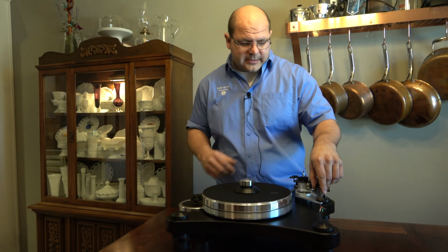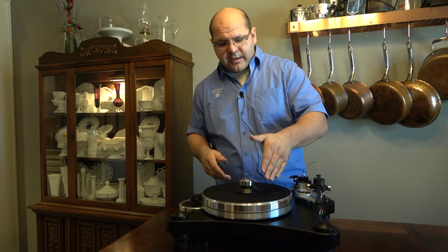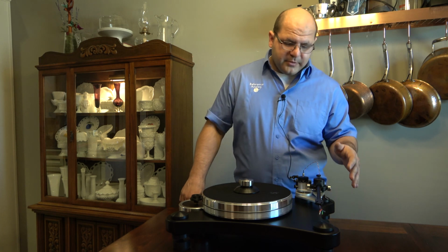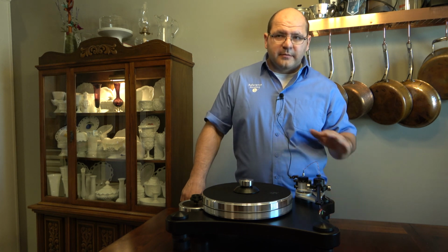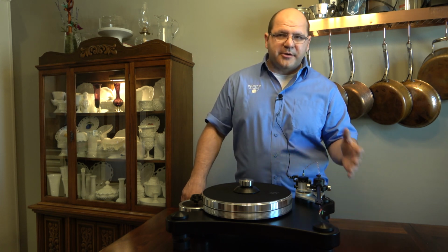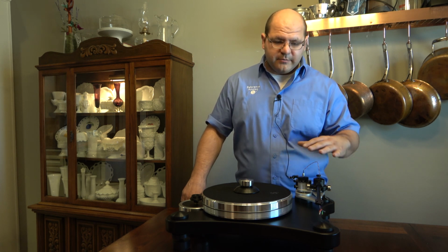Your azimuth is essentially your pitch, so that is going to be the side-to-side pitch. If you think about your stylus, as you change your azimuth, your stylus is going to be doing that. So you want it going in accurately to the groove and tracing the walls correctly. Okay, so azimuth is side to side and vertical tracking angle is up and down. Yeah, and they talk about a 92-degree rake angle and stuff like that with a USB microscope. That is kind of done with the setting for the VTA. So that's what you set with that.